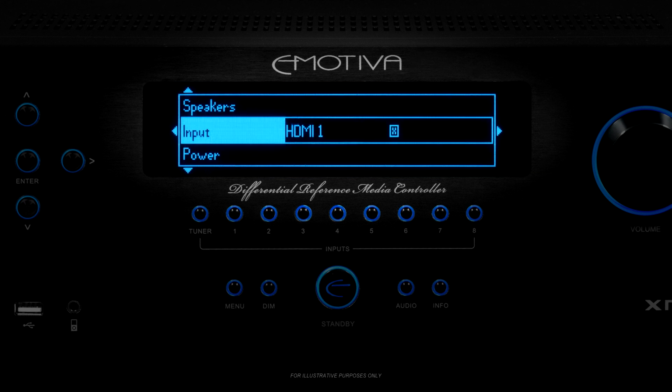At this point, you will see a group of checkboxes that you can configure. You configure your XMC-1 so each trigger is on when a set of specific conditions are met. In general, when a box is checked, then the item next to it becomes one of the conditions necessary for that trigger to be active. It turns out that rather than thinking about which boxes to check, it is easier to think about unchecking the boxes for things you don't want to turn on the trigger. This is why, out of the box, the XMC-1 is configured with most of the trigger conditions already enabled.